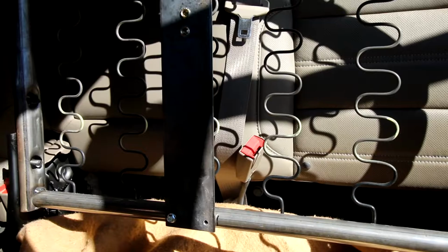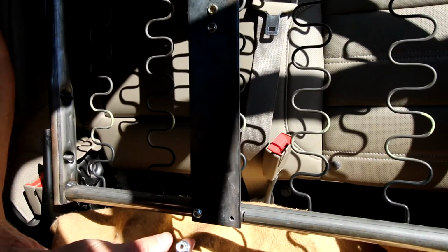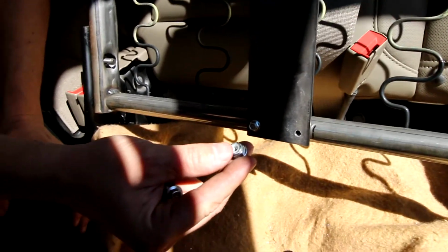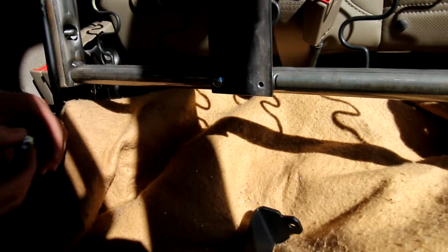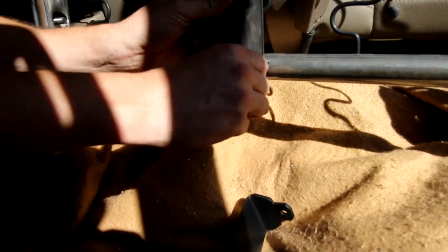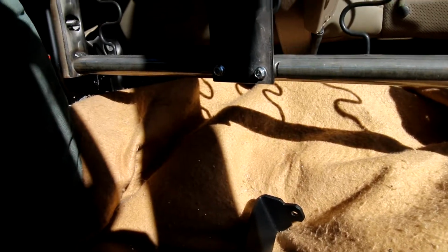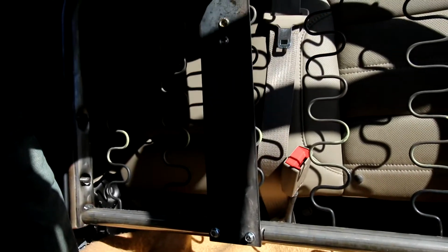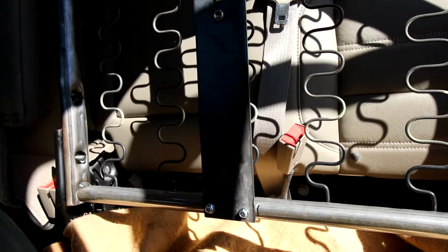And we do supply you with a nylock washer, so you don't have to use any Loctite. You can if you want to, but this is a nylock nut. Once you take the nylock off, it pretty much destroys the plastic and the locking ability a lot of the times. So you would have to apply Loctite if you mounted it and then took it off again.